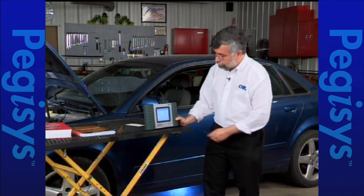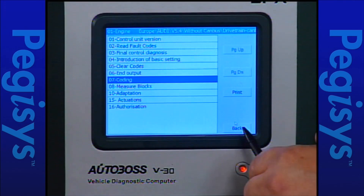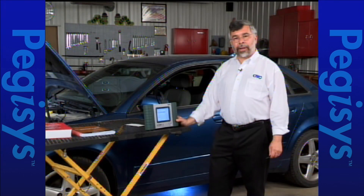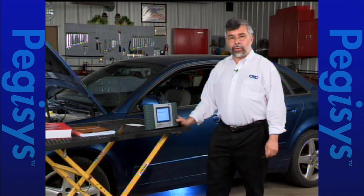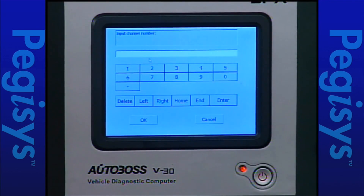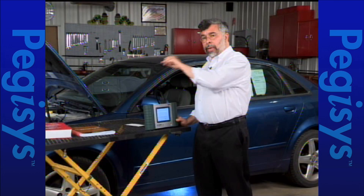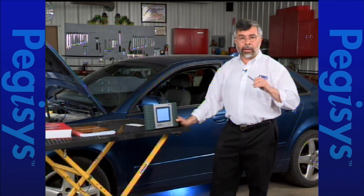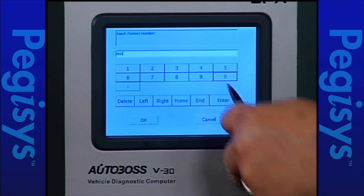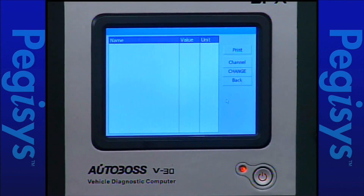The code is now listed in our tool and on the controller. Now we're going to do another test — throttle adaption or throttle relearn. To do that I'm going to go to 04 basic settings — introduction of basic settings. Up comes the block measurement device where I have to enter my numbers. I need my shop manual to find out what measuring blocks I need for this particular car. I'm going to type in the number 0060 for my 2004 Audi A4 with 1.8. I'll press enter and up comes my values.